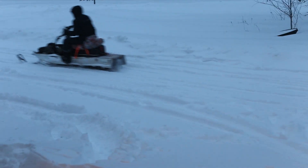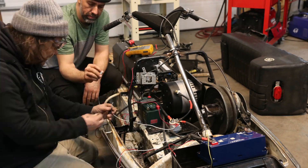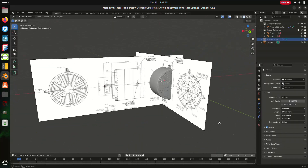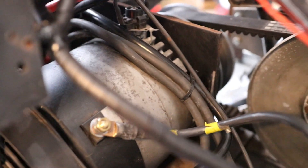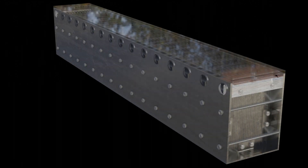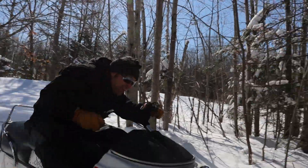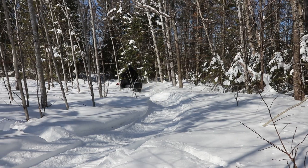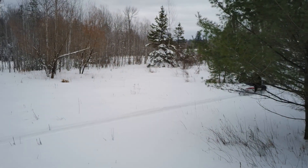I've built this snowmobile in many different ways. The first rendition used some batteries in a 48-volt configuration, a controller I had on hand, and a Mars 1003 brushed electric motor. The motor has stayed the same through all the renditions, but I've used different battery styles, configurations, and controllers. We tried 96 volts of pouch cells and that was a screamer - almost too much, it scared the kids. At 48 volts it just wasn't quite snappy enough to really get that track going in deep snow.